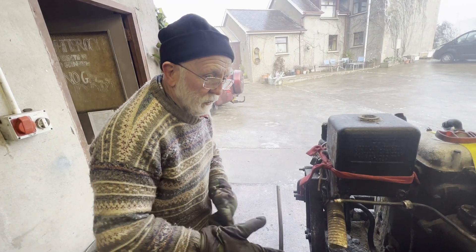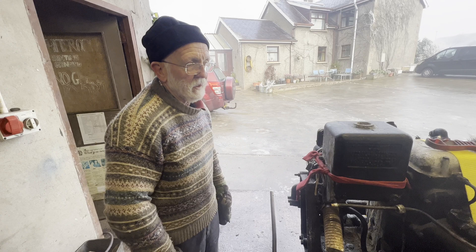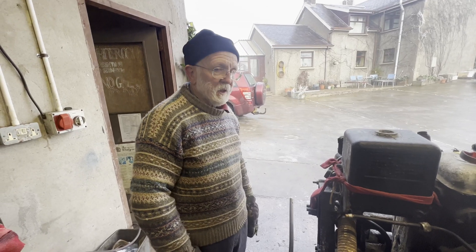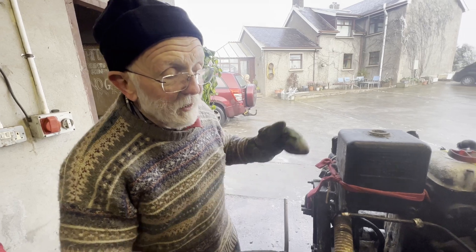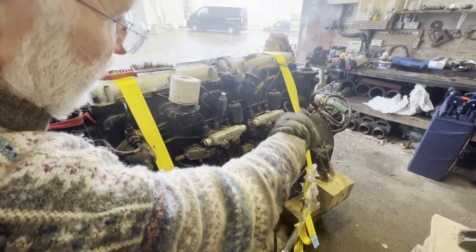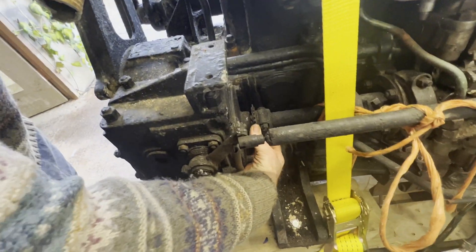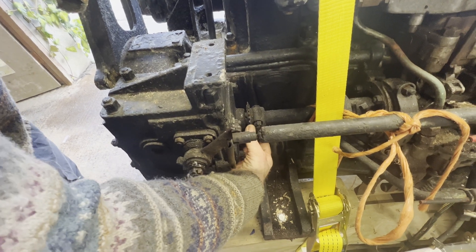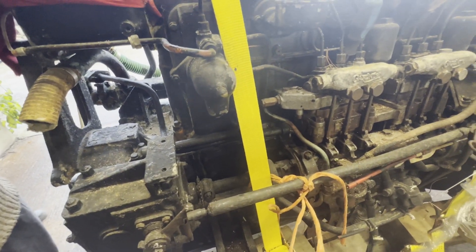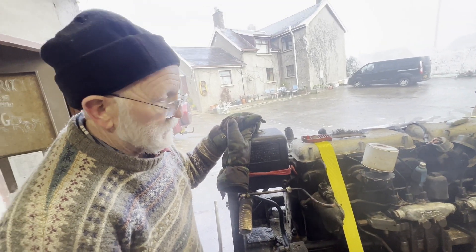The sumps are both typically automotive — they're alloy — but again it's no big deal. Our plan is to send these two engines off to be soda blasted. First we'll take off the injector pump and anything critical, and anything perishable like the hoses at the back. This gear on here is also typical of a drive for a hydraulic pump for brakes or steering — so really quite interesting engines.